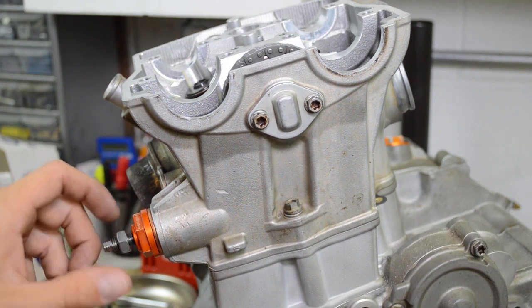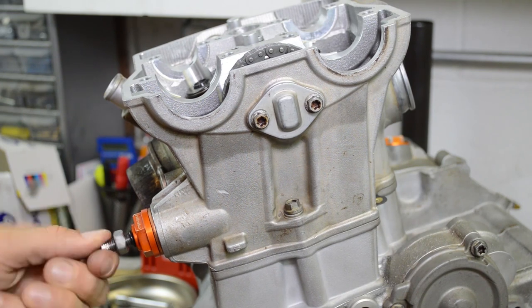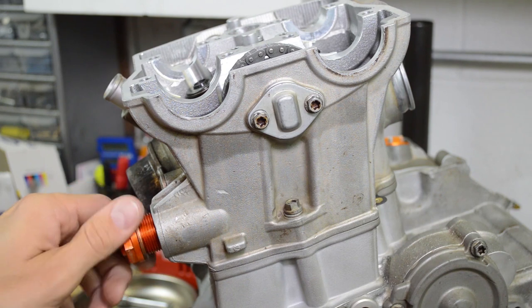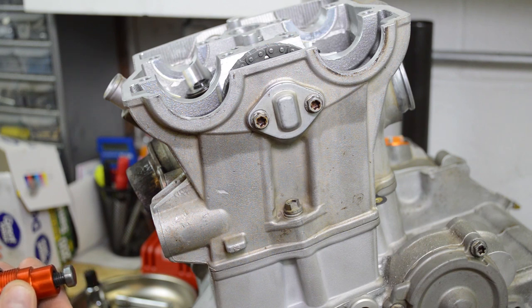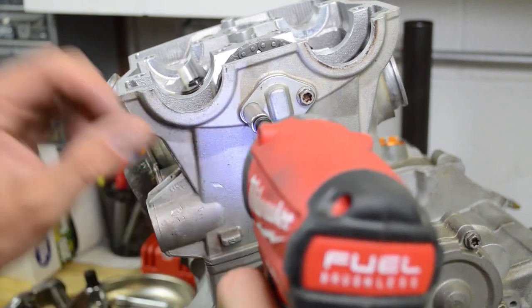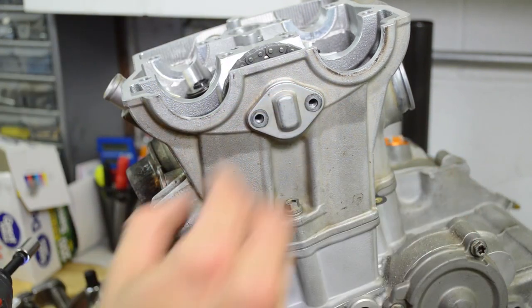And basically this one's really easy to set up, but if you loosen this lock nut and back off this screw here, it releases all the tension and it just removes like this. Again, everything's loose. I don't have a stock tensioner to show you, but basically, see, this just moves the plunger in and out, and that's how you get your tensioning. And they put a block off plug in here to cap the stock oil passage. Okay, next up, let's zip off these fasteners. Remove this cover.